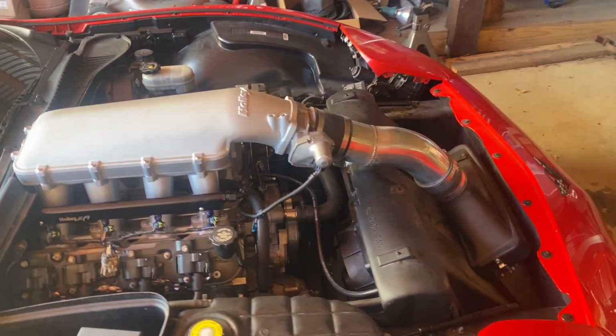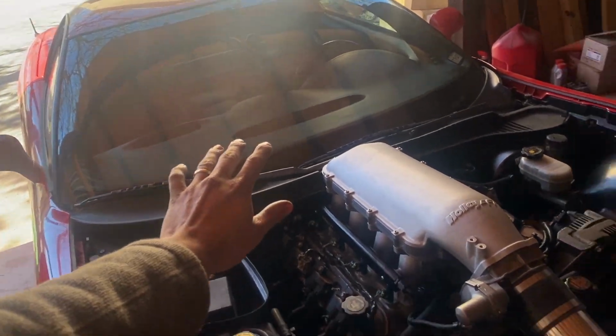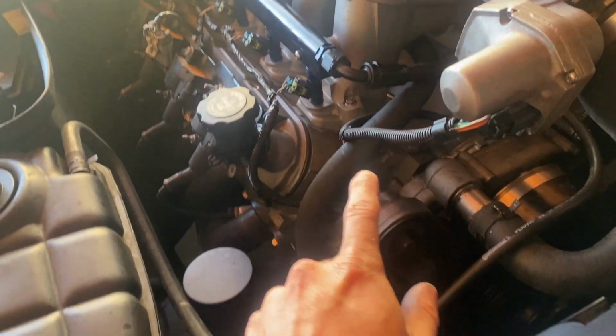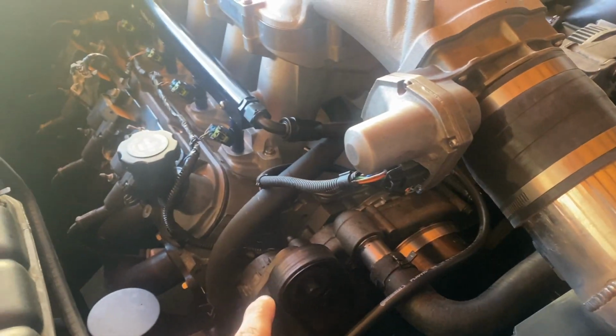So I took it back apart, put it back together, 2 degrees retarded, called a buddy, and asked him, hey, does this make sense? I just needed a second opinion. He talked me out of it, so the camshaft was fine, especially with the high ram. So then I put it back together, and this is at like 10 o'clock at night, and I forgot to torque the cam down, believe it or not. So all the oil that was splattering up on my windshield was from a massive hole in my timing cover. But now I've got the catch can system fixed better.